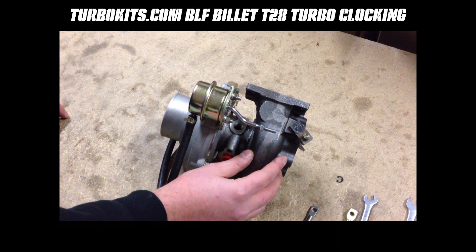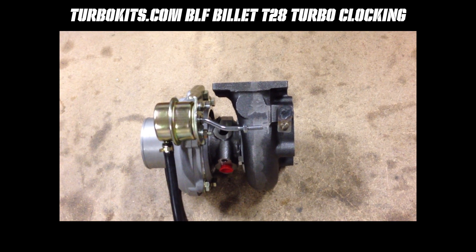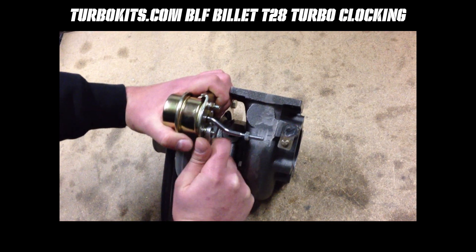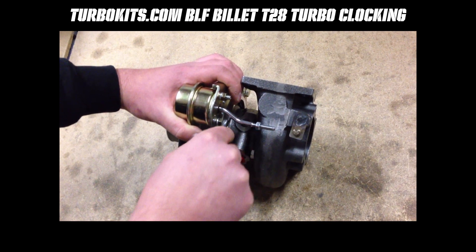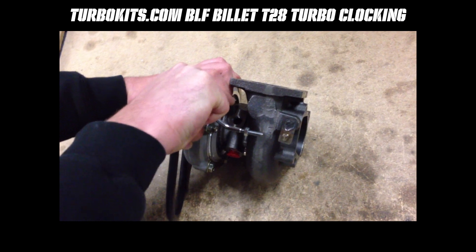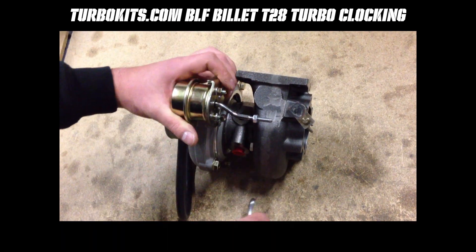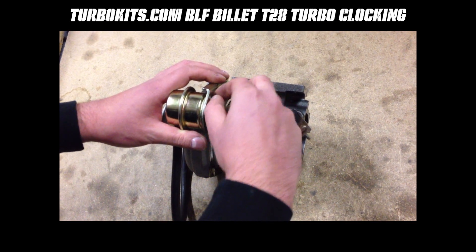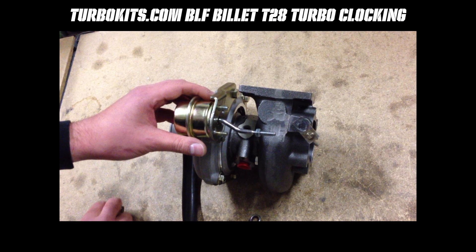Flapper disconnected, eyelet arm off. The next step is to remove the actuator. Using the 10 millimeter wrench, loosen the two nuts on the bottom of the wastegate actuator to completely remove the actuator from the bracket. We suggest doing this because it gets out of the way as you're trying to clock everything else and just makes the job a lot easier on the bench. Save all the hardware in a safe place — you will need to reuse everything, and the last thing you want is to get to the point of putting the turbo on the car and realize you're missing something.